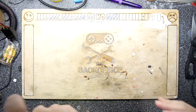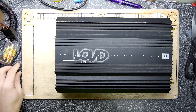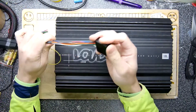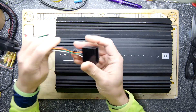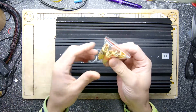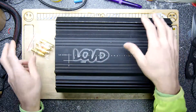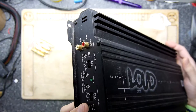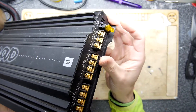What you'll need for this project is a splitter to split your head unit output. You'll go from BMW output to the standard ISO connectors — which are the opposites of these — and then you'll need something like this to connect that to your amp, because this particular amp has phono inputs. Then you have all the masses of speaker outputs if you've got a 12-speaker setup.